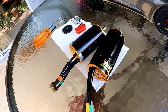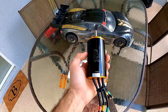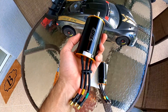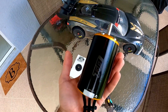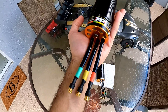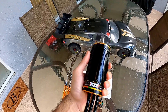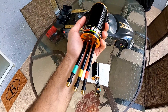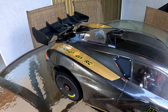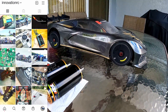Our eyes go right to these big whopping motors. This motor over here was the previous motor run in Spartan at over 150 miles an hour, and this motor definitely has a lot more in it. But I wanted to try a larger motor and see how it performs. Regarding soldering the bullets on - we can see how big this motor is with the whopping 8-gauge wire. This 22-horsepower motor is going to have even larger wire: 6-gauge, about a quarter inch thick. I already soldered these earlier, so I'll show you the correct way. Be sure to follow Innovation RC on Instagram for more content.